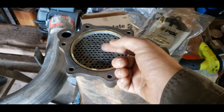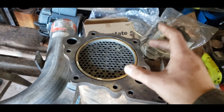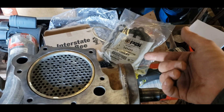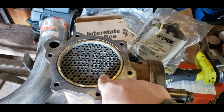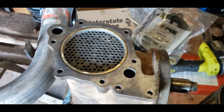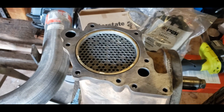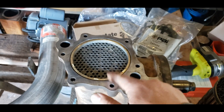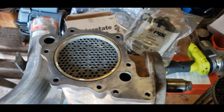This looser ring can't come off because the plate will hold it on one end and the block on the other — but will it back off just enough that the O-ring creeps forward and things start leaking? I don't know. I get irritated when ordering parts: one kit had retaining rings that go in easy, the other didn't. I don't know which is right. You should not have to hammer these in — tap yes, hammer no probably.